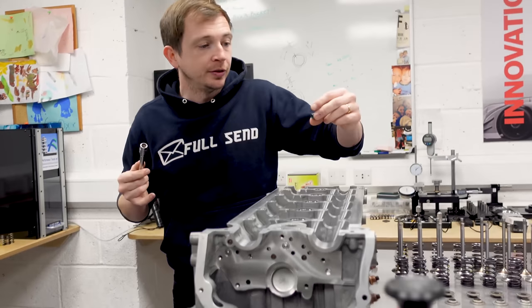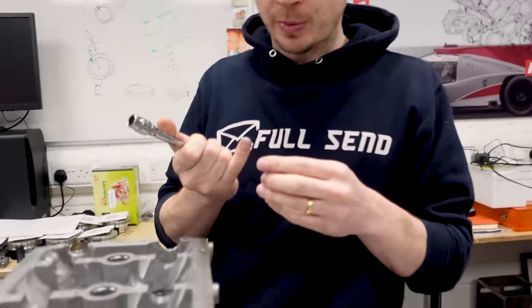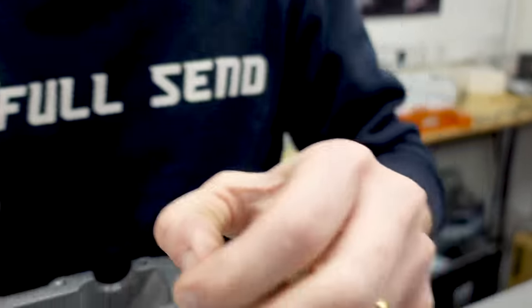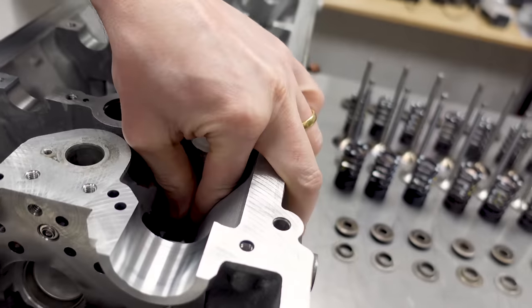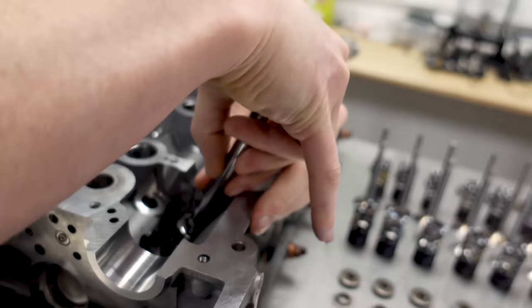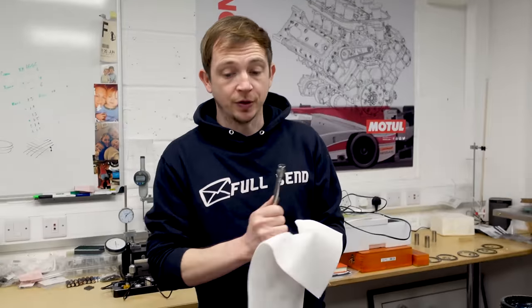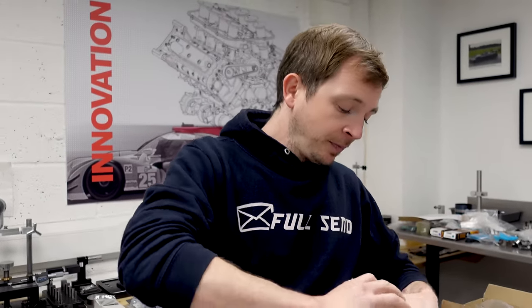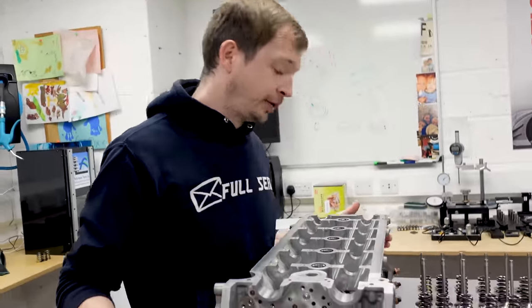The metal cage down the side can take quite a bit of abuse - you're always trying to protect the green seal on top and the metal spring, which keeps the tension on the valve stem. When you start to get leaking valve stem seals it's normally because the integrity of the rubber on top of the seal goes quite plasticky, so then it can't grip the valve. That's down to age and lubrication - if you've got poor oil in it, oil goes down the guides to keep lubricating them.